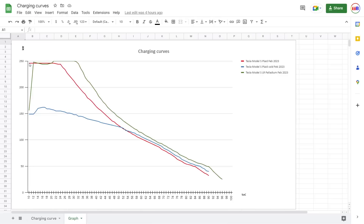What is nice about the Tesla is that it goes so fast. You get a nice flat 250 kilowatt until around 30-35%, and then still get only a slight slowdown. With this charging curve, like I did in the 1000 kilometer challenge, I charged to only 45-50% roughly and then just hammered it to the next one. So you have a very nice average speed on the charging session. Because this car has such good range, you can actually drive relatively far just on 50% battery, even in winter, even with headwind.